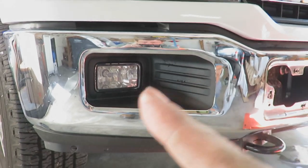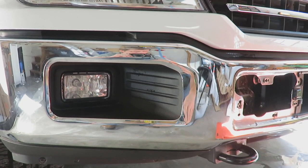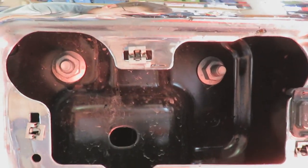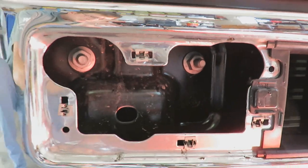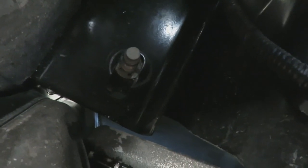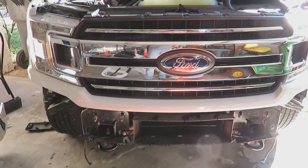The other thing I did was disconnect the fog lights. There's a plug on the back side — it's kind of awkward to get to, but it looks like every other electrical plug. Little clip on, unhook the clip, it comes apart. According to the interwebs, there are two bolts on either side on the front and then one on the inside — this is a 21 millimeter. So that's three bolts on each side. Six nuts later, off it goes.